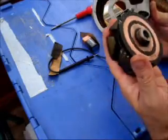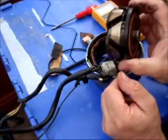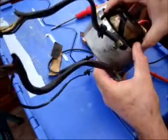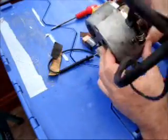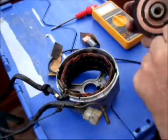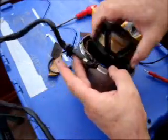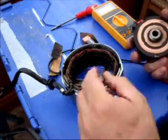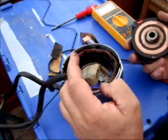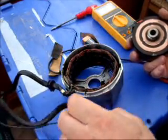Just to clarify, this is the rotor and this is the stator. The rotor bolts on the end of the crankshaft and it spins at crankshaft speed inside the stator, which is fixed in the engine casing. It's the voltage that goes through the rotor that creates an energy field inside the stator. When it spins inside that stator, it generates an AC voltage which is rectified and regulated by your rectifier and regulator, and then charges your battery. So that's basically the basic charging system.